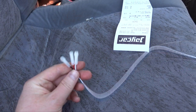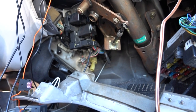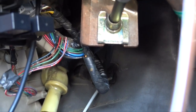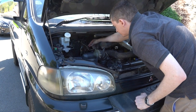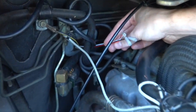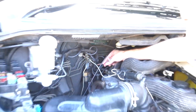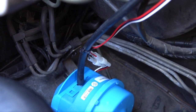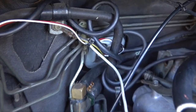We have to get the wiring through the firewall. Looking under the steering wheel toward the back left, you can see a white cable that goes into a rubber grommet which passes through the firewall. You need to punch a hole in that rubber grommet if there isn't one already — better to use the existing hole — and feed the wire through. That's the cable coming through the firewall on the left side of the engine bay. We've plugged in the vacuum actuator — red to red, black to black, blue to blue — and I've cable tied the cable off so it doesn't touch anything hot and stays away from pipes, then it disappears into the firewall.